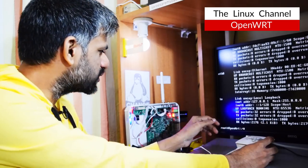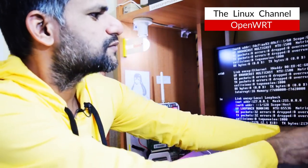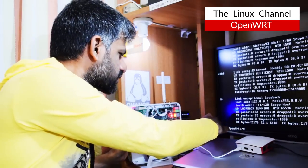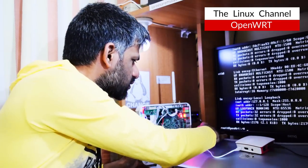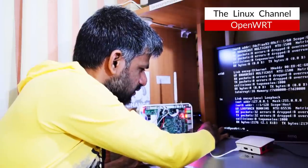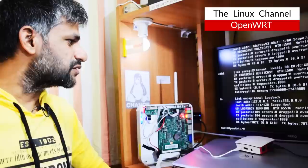So the moment I connect to this WAN port, okay, hopefully the other one is the WAN port. I'm not sure how far this cable is. Yes, if I connect to the port below, the cable is quite tight. Let me just pull a bit. Yes, if I connect to this WAN port, and we see if it pulls that IP from the DHCP of the Xiaomi router or not.